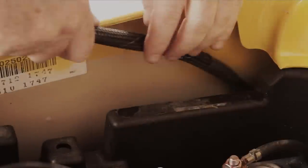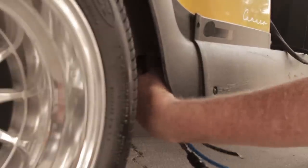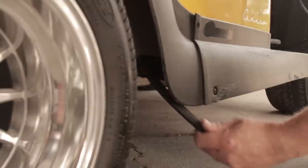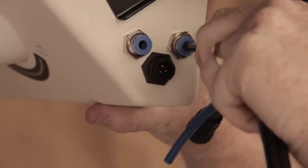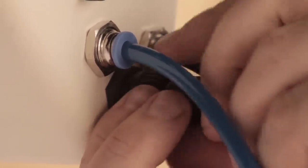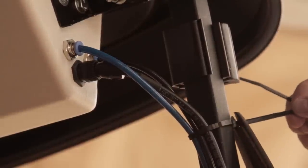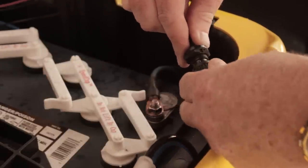Route the tube and wire harness under the seat into the battery compartment. Next, route the harness out of the bottom of the battery compartment under the car and forward to the wheel well. Secure the harness under the car with the two cable clips provided. Route the harness up the canopy support to the control unit. Connect the air and water tubes to the connections on the control unit, then make the electrical connection. Secure the harness with zip ties where needed. Connect the battery harness to the main harness coming from the power unit using the electrical connectors.